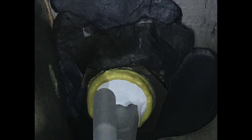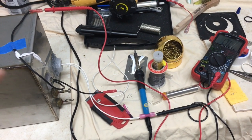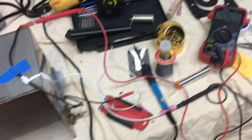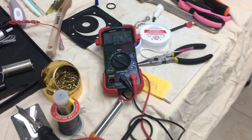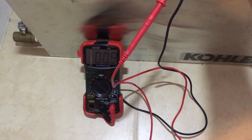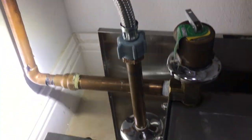Here's a view of the inside — the pipe thread sealant leaked a bit but that's okay. The water test passed with no leaks. I proceeded to connect it electrically with the float switch in series with the thermal switch — tapping the float switch gives 0.2 ohms, which is good. Putting it back together, I turned on the water to test the float switch — it worked perfectly. There's a small leak to fix in one spot but I don't see any leak on the other side; the main leak appears to be just in those two spots.